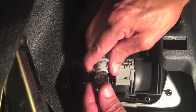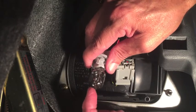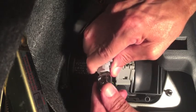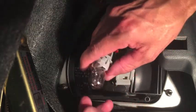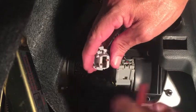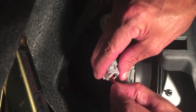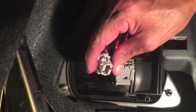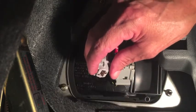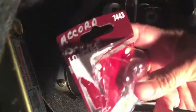Some other things that may trip that brake lamp indicator light: your bulb may just be loose. If it looks like you have a good bulb — no discoloration and no burned-out filaments — you can try wiggling the bulb to see if it just worked its way loose from normal operation of the car. Or if you pull the bulb out, grab the base in one hand and the bulb in the other. You'll see these metal contacts inside — you can take a piece of sandpaper folded over and just reach down in there and sand those contacts to get to some fresh bare metal. Sometimes that's your problem, and improving the contact will make the bulb work again.